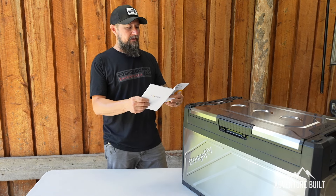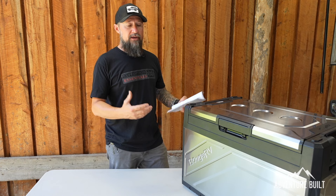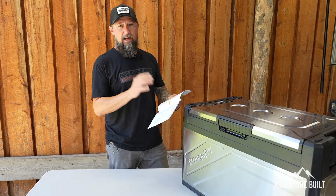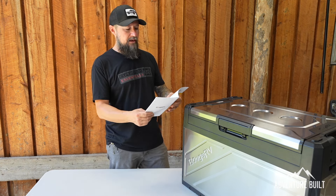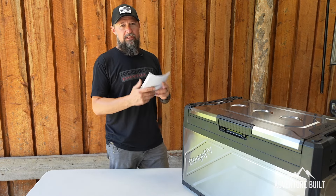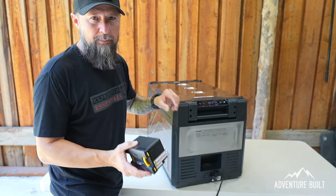I got the F1 error code a third time and finally pulled the manual. It turns out there's a car battery protection voltage mode. There's a high, medium, and low setting and the directions specifically say: if using a portable power station, you must use medium or low setting. So I swapped it to low — I shouldn't need that error again, but I'm putting the battery back in just to confirm.